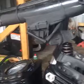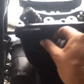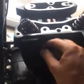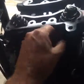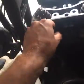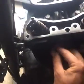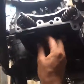But you put those in, hand tight again, like I said. There's not much to these as far as assembly wise, but it's a very important, if not the most important, part. And these go right here. Kind of hard to see in the shop. Now these are inverted Torx, so actually one of the few inverted Torx bits that are on this bike. Mostly everything is hex, and then of course standard, because it's a Harley, not a Jap bike.